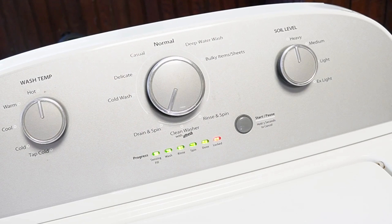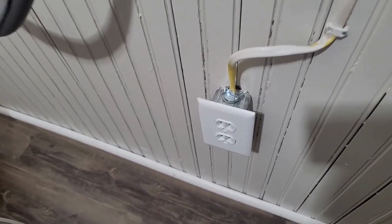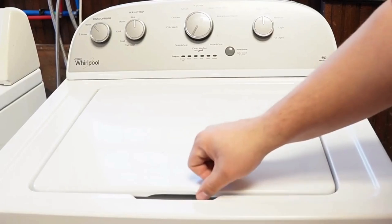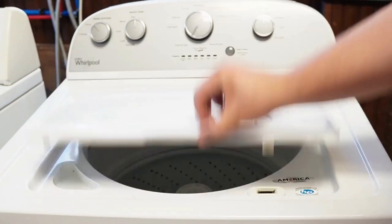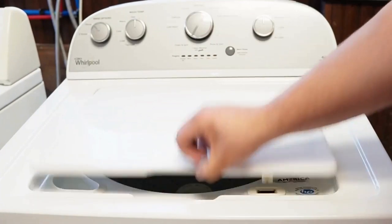When the calibration mode is at the end, every single light is going to turn off, including the lid lock light, and the machine is now ready and recalibrated for use at an optimal level. Now let's try one more reset technique. Unplug the washing machine and let it sit for about one minute to drain any capacitors or memory, just like we did the first time. Then plug the washing machine back in and let it sit for a few moments. Then open and close the lid six times in under 12 seconds. This works on some but not all models, and it will issue a reset command to the washing machine to clear any issues beyond what the reboot or reset mode did.